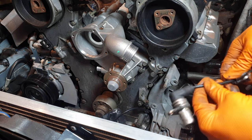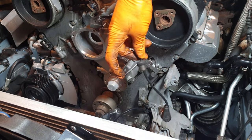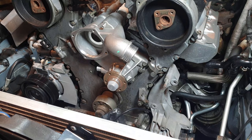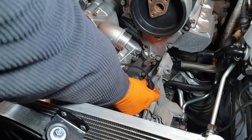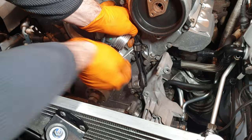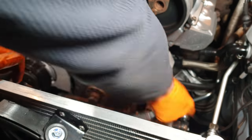I'm reinstalling the upper crank position sensor. It locates into that bracket down there, there's a cable tidy here, and it mounts on the front of the block at that location. I've got my new sensor — I'll slide it in, line up the bolt hole, and that cleans them both up nicely. Happy with that.